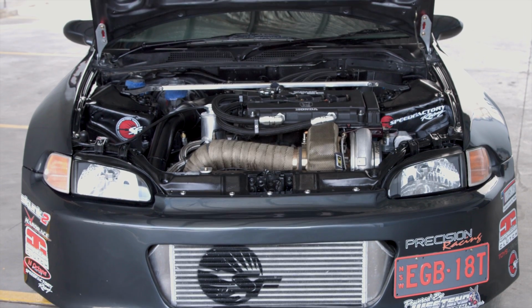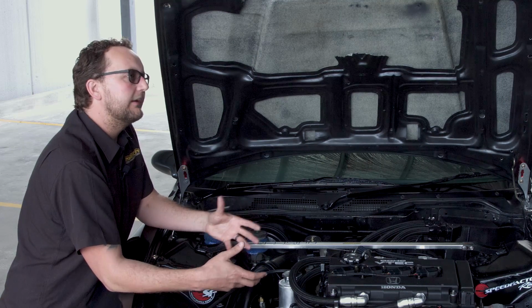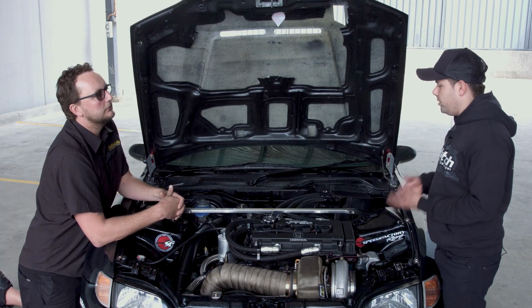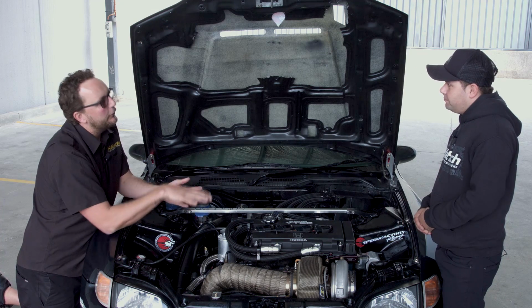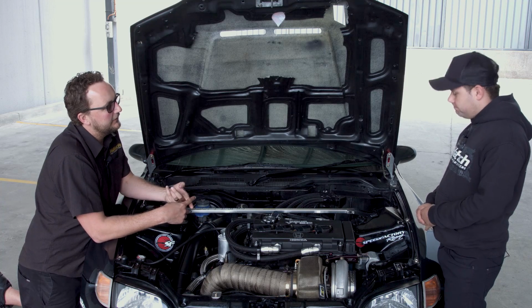So when you're putting sleeves in an engine like this, what are the complexities with that? Have you been having trouble holding it all together? The biggest issue you have when you sleeve an engine is it not sinking and pushing water. Right, so that means if the sleeve falls down a little bit, you end up with compression and water trying to mix in there. That's correct.